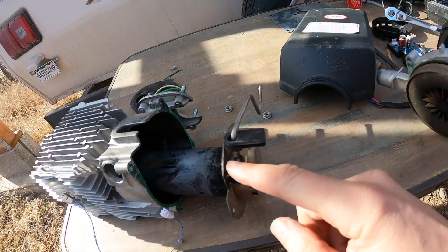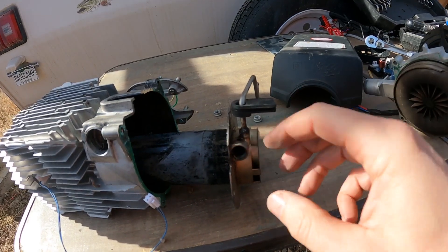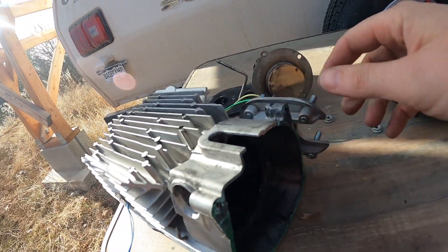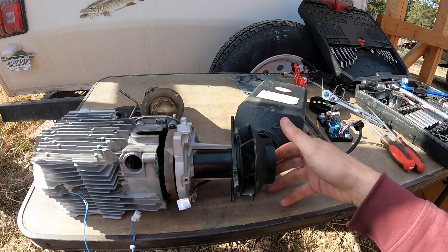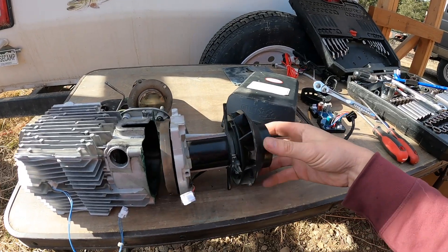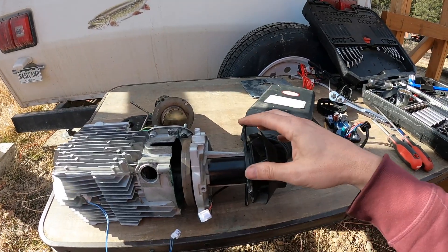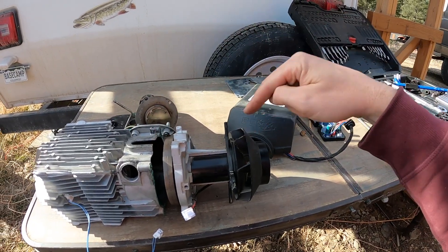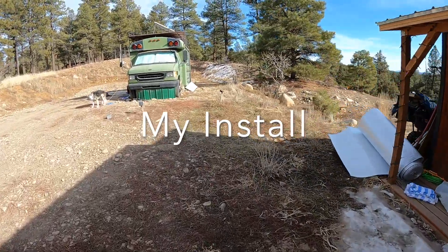The fuel is going to be coming in this pipe and right here is where your glow plug goes — that's what the fuel is dripping on. Here's the combustion chamber itself, basically just a piece of metal where it's burning things, and then the exhaust comes out the bottom. This motor that operates both fans means you cannot adjust the fan speed going over the body without adjusting the air going into the combustion chamber. The only methods you have of control are the fan speed and how much fuel is getting delivered.